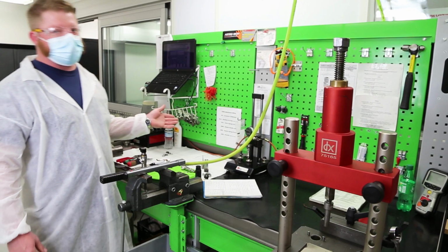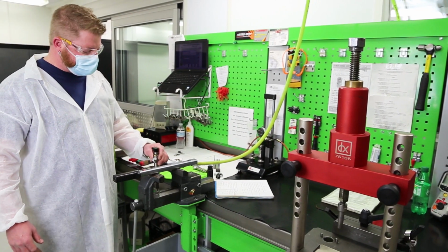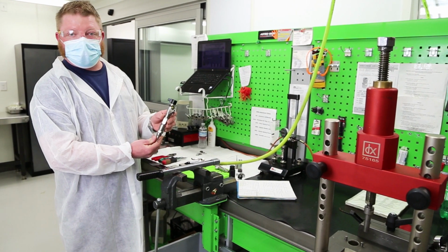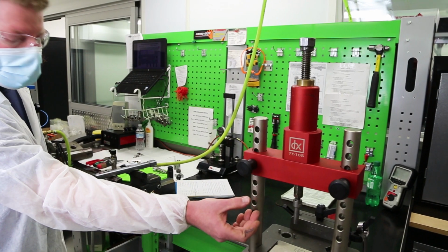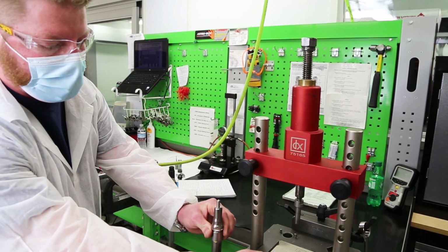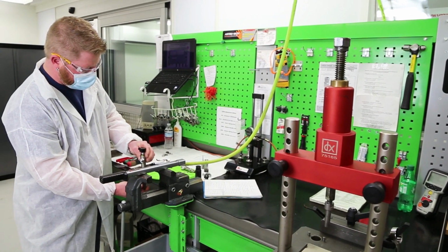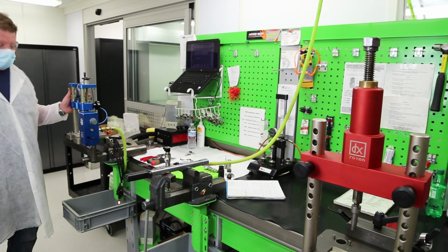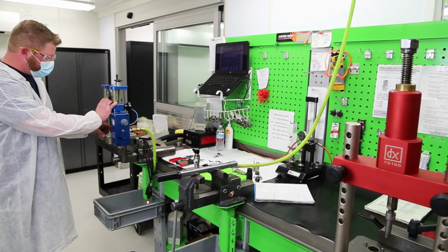required. Here we have our KenDiesel bench. This is where we build our MAGNUM line of injectors. 7007 for a Ford 6.4 liter. This piece here is where I compress the nozzle down as I tighten the nozzle nut. This item back here is the device in which I measure my needle lift in my nozzles.